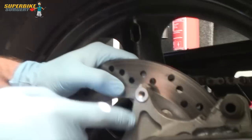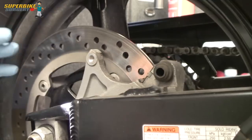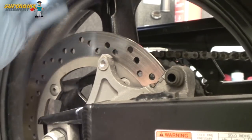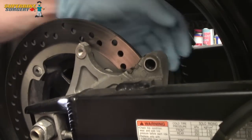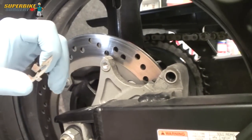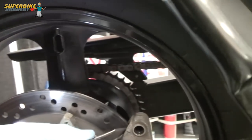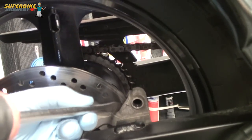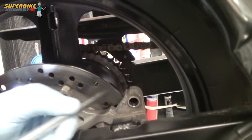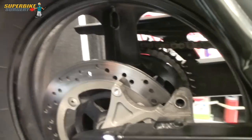Worth mentioning: the calliper carrier isn't removable without taking the rear wheel out - it's part of the mechanism that holds the wheel bearing and wheel spindle in, so the calliper carrier will stay in place. There are a couple of components to remove though: there's another rubber boot which fits inside, and another little shim that the pads rest on. Sometimes you get a buildup of corrosion on this carrier that can cause the brake pads to bind. Use a flat-bladed screwdriver or scraper and clean that off on both sides.